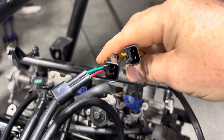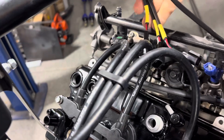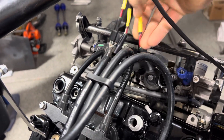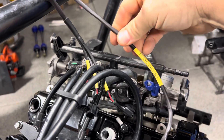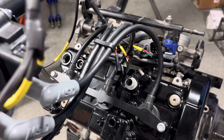This other end is going to plug into your factory wire harness where the coil packs used to plug in. This routes up along the frame and then drops down onto the valve cover. You just plug your three wire harness plugs in — instead of plugging into a coil pack, they plug into this harness. The other connection is your ground for your engine, which fishes down towards the front and picks up a ground on the block.